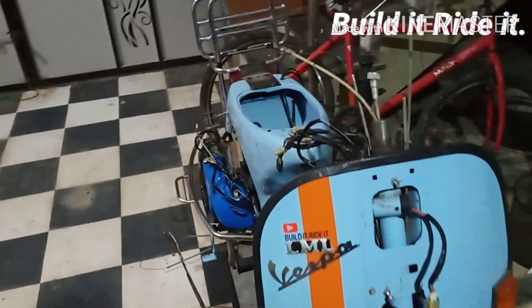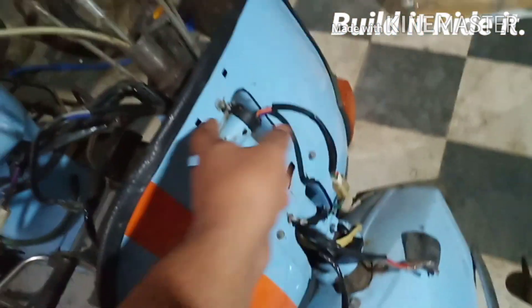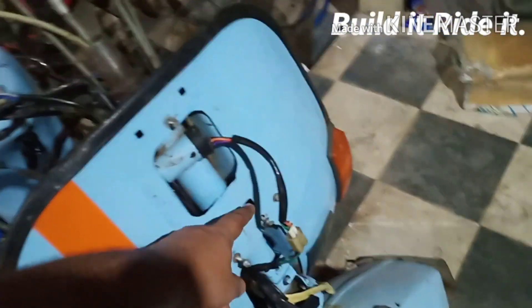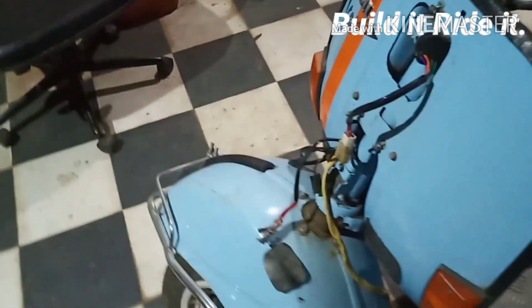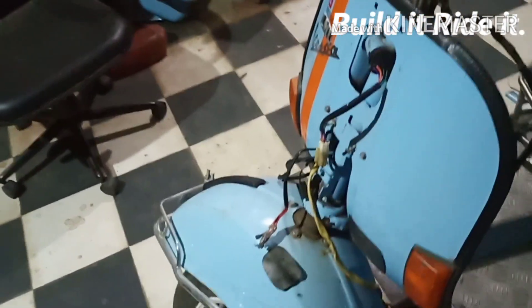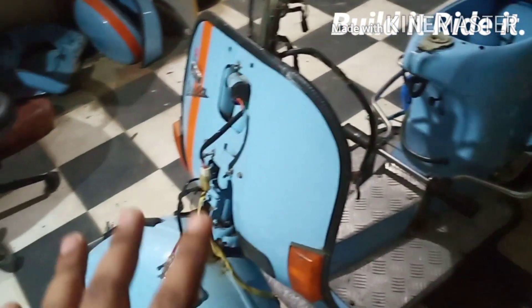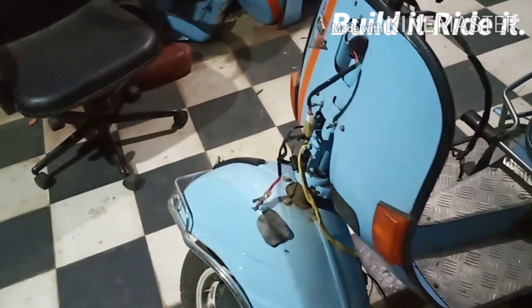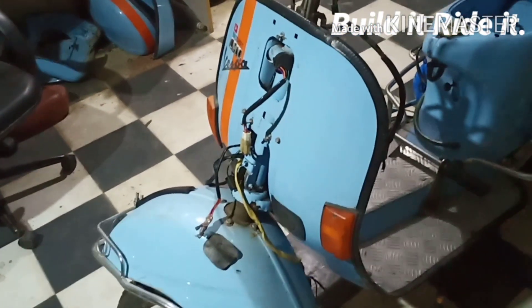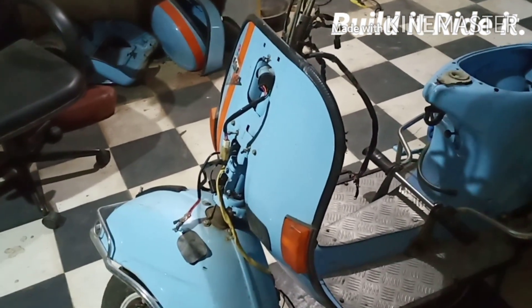It's 5am in the morning, and right now the status of the scooter is this: most of the cables you are seeing have been passed through these two holes and have finally reached over here, as you've seen in fast forward. Now we have to make connections — we'll be installing the horn adapter over here, the PRD relay will be going here, and the buzzer which used to be the factory-spec unit will be going here, although I'm trying to skip that because it's not really functional. Instead I'll be using a simpler aftermarket flasher-cum-buzzer unit which is available in the market for around 50 rupees. We'll try to install that, but first we have to install the basic components already on the scooter.